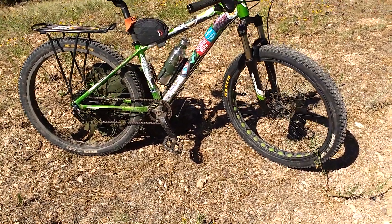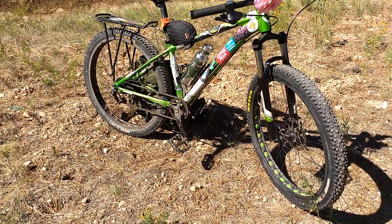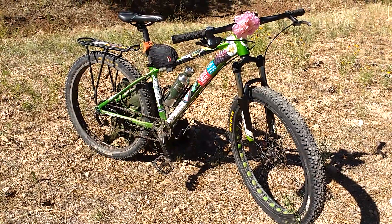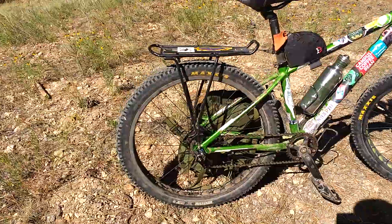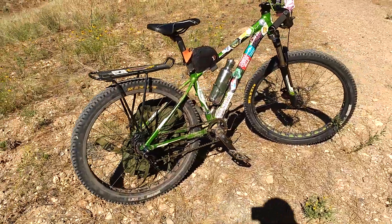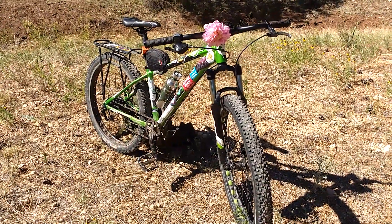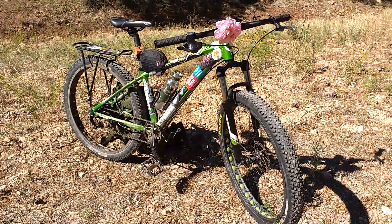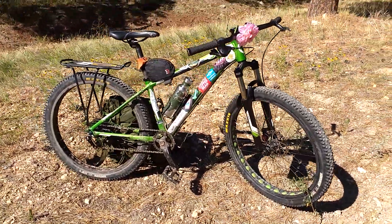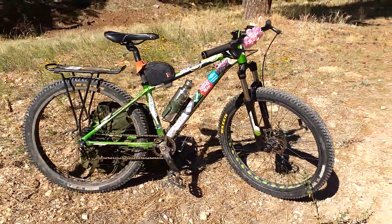I hope you found this informative. If you're going to use the 50mm Surly Rabbit Hole rims, I'd recommend using at least a 2.5-inch tire, if not a 3-inch. Otherwise, go with a narrower rim. Ride an Alfine gently, I guess — it's been kind of a trial for me. It's nice to have a mountain bike that works, and that's not always what's happening with the Alfine 8. Leave a comment if you have any questions or your own experiences, because I know I've had some issues and I'm not sure everyone else has. Thank you for watching and have fun on the trails.